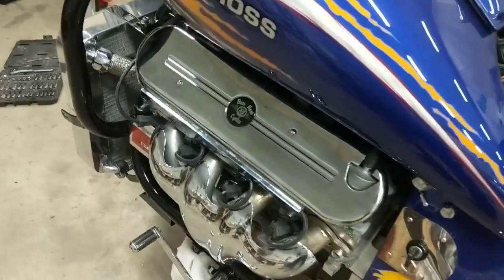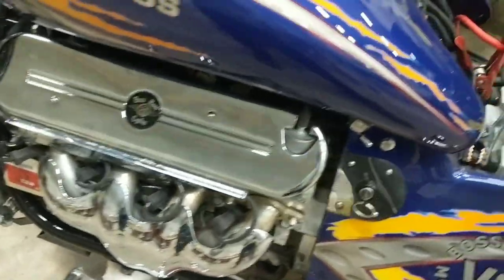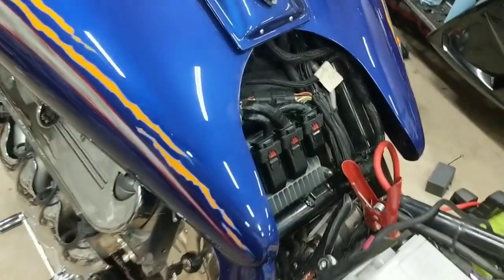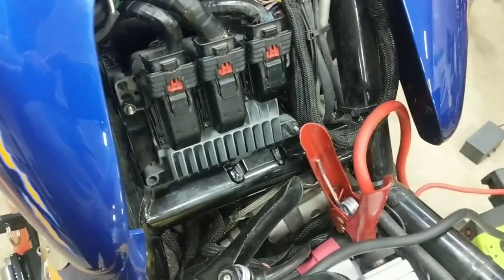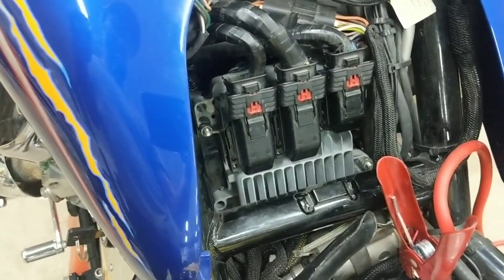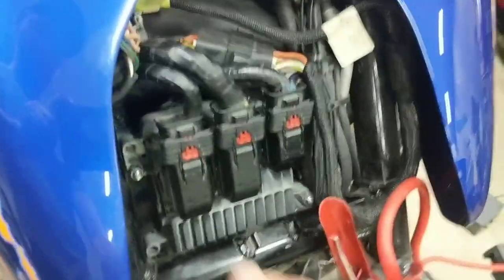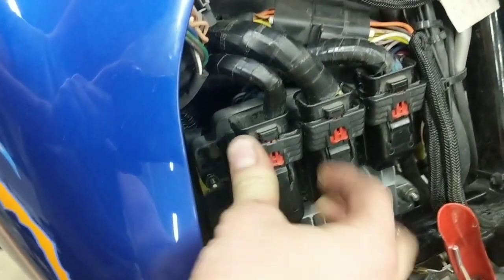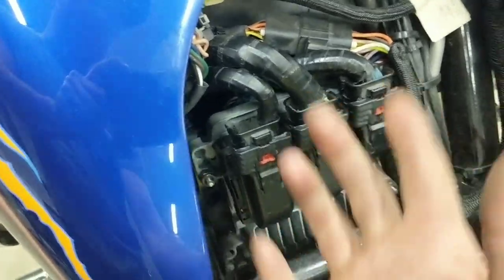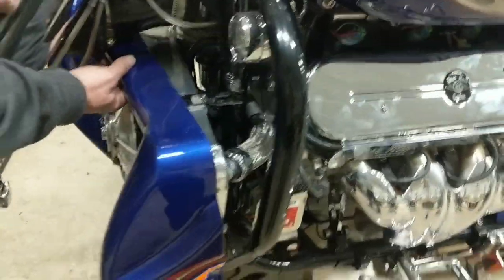As you guys can see, we have the valve covers on now. All plug wires are reattached. We also have the saran wrap off the gas tank with the computer installed. The computer is two 7/16ths nuts and bolts holding it in, and then the connectors you just simply push down here - it unlocks the connector, and then you have your locks that actually secure everything so it can't ever come undone accidentally. The next step is to get the radiator shroud in place, done with two thumb screws that use the special Boss Hoss tool as well as 7/16ths nuts.